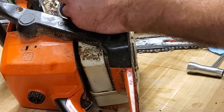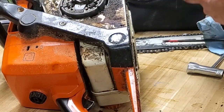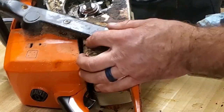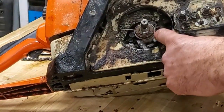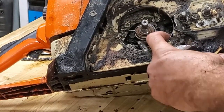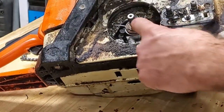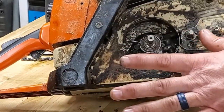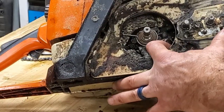Reverse thread on the clutch — I'm just tightening to make it come loose. Pull that off. Here's my oil pump. There's the rubber hose I'm talking about that comes out the bottom and then comes up into the tank. It's not really saturated up in here, but it's extremely dirty. We're going to have to change out this hose.